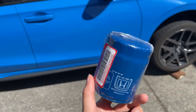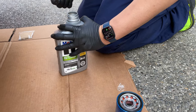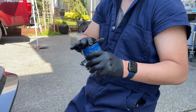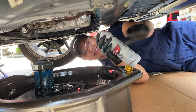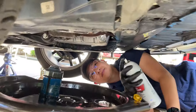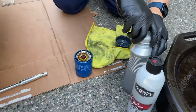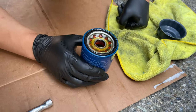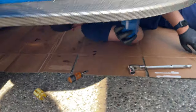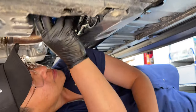This is the oil filter we're using — we got it from Walmart but you can get it at most places. Before we put in the oil filter, we're going to lube it with some oil. We're also going to use this parts cleaner spray to clean up the area — obviously, do not inhale the parts cleaner. We usually pour in some oil before attaching the new one; we completely forgot why, but it's become standard practice. Then you can twist the new filter back on.